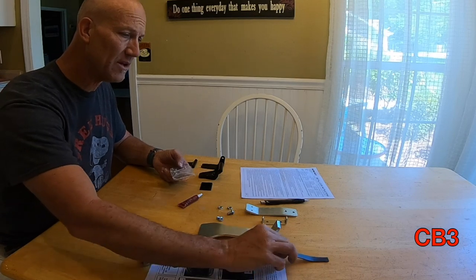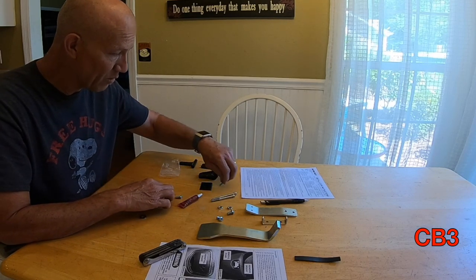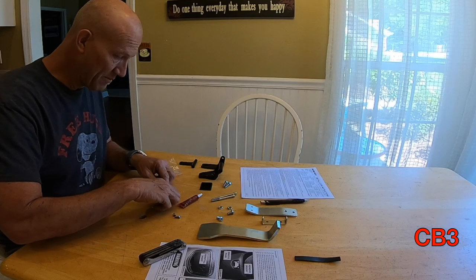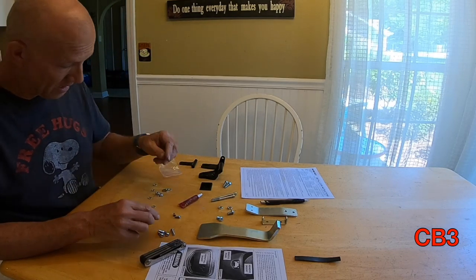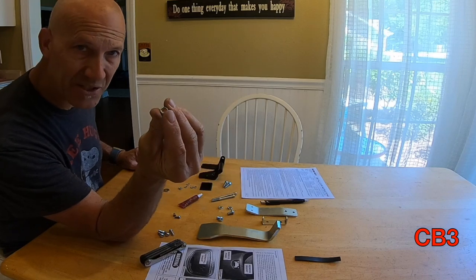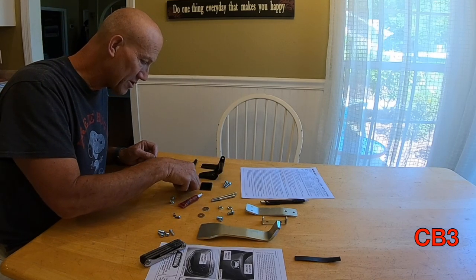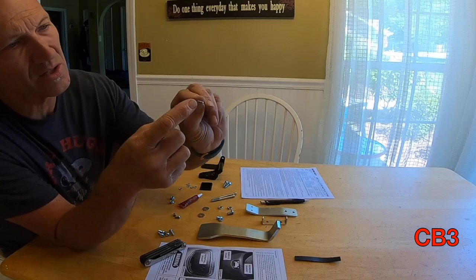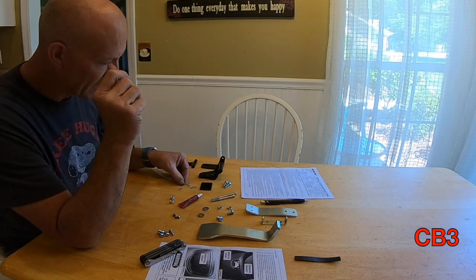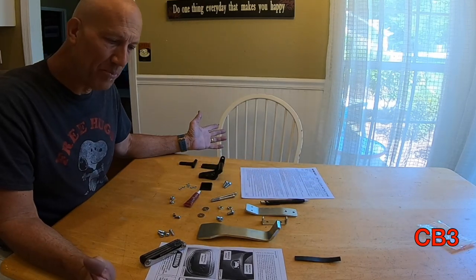You've got a lot of nuts, bolts, and pieces, and you want to make sure you use the right ones in the right places. I don't have a clue where any of these are going yet — I'm dividing them up into sizes. Lock washers, lock nuts with the little plastic piece in there that locks the nut down, standard flat washers. A lock washer has that little cut on it — you can see it's not even — and that groove of metal, when you tighten it down, digs in and keeps it from vibrating loose. Therefore you don't need Loctite, though I'm going to use it anyway.